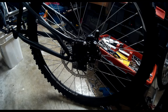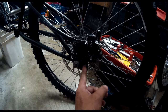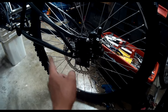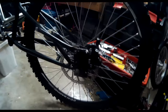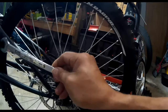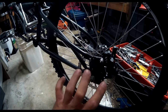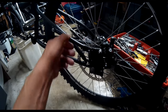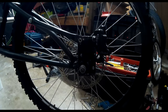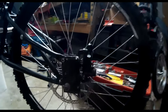I've done really hard braking going down Hamilton Mountain with a full load and it's never moved. I'll take it off, buff it out, and paint it the same color as the frame. You're going to need this bar here — you can make it out of pretty much whatever you want, even an old wrench if you had to. You'll need to drill a hole through your frame and bolt it to that, because every time you hit the brakes it's going to want to twist and will break free the nut. That's really, really important. It's really thin and light aluminum and it's never failed or buckled. So it's a nice little adapter — nothing fancy. If it works, why mess with it?